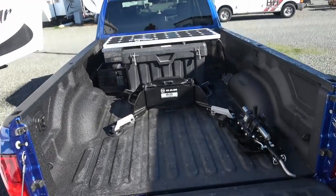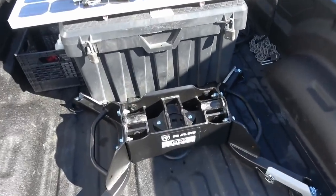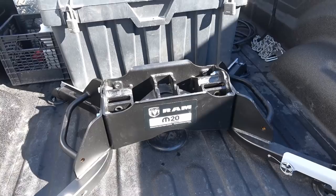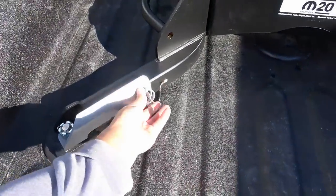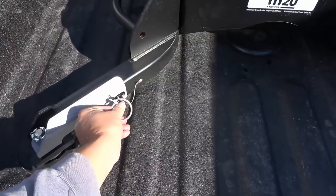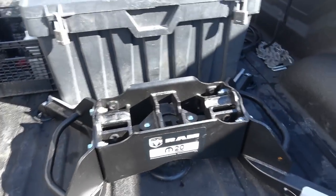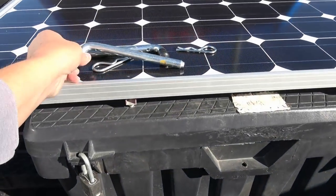I'm going to show you the RAM hitch here — kind of have it apart, I was just adjusting it. It's actually a rebranded, I think Curt — I think someone said it was a Q20. Anyway, it looks like a pretty good hitch. See, this is the puck system here. It's got these little clamps that come out — just go like that to all four legs and it comes right out. The head just pops out; take out these little pins here and you can lift it right out.